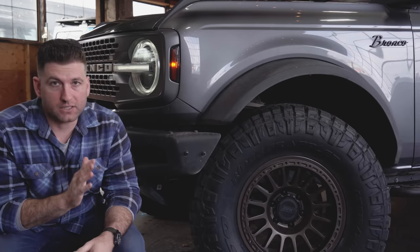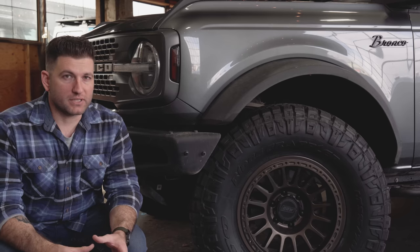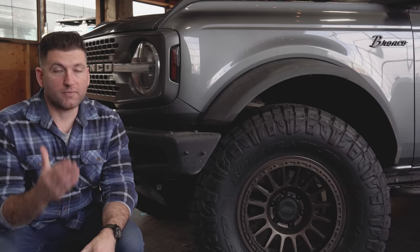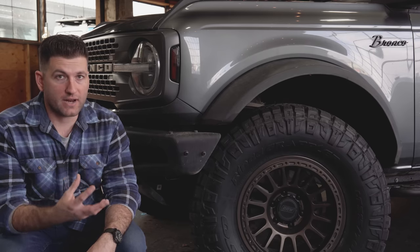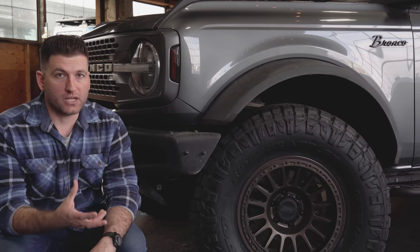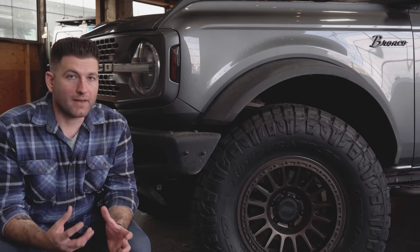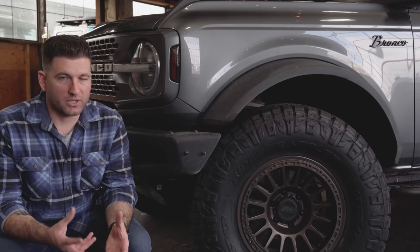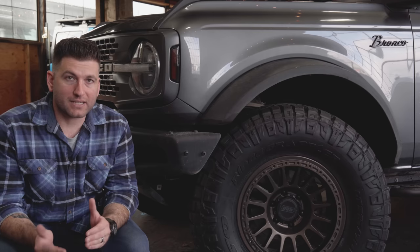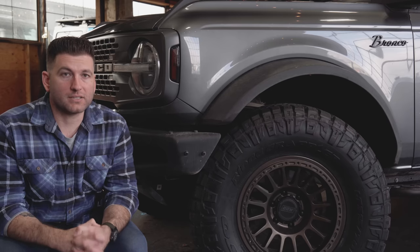The other thing I've done on the front end of this vehicle is address the steering rack. The weak tie rods on the Broncos have been well documented, but I believe there's some misconception happening there. The tie rods are weak because they're designed to be weak — they're supposed to be the failure point. The next weakest part of the steering system is the steering rack itself. It's far easier for the tie rods to break and for you to fix that and get off the trail than if the rack itself were to fail. So what I did is I got the 74 Weld billet aluminum end cap and bushing kit and then the Icon tie rods. The end cap is extremely weak from the factory — it's cast aluminum and it would be the next thing to fail if you upgrade the tie rods without upgrading the end cap. So it's really important to do both of those things at the same time.